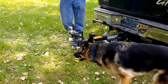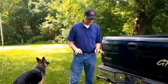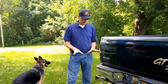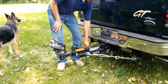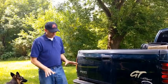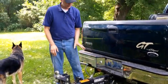This particular setup we have towed into the Rocky Mountain National Park and pretty much across North America, and we have never had a problem with it. The only thing you want to do is, after about 50 miles of driving, pull over and make sure these are still tight. What I've found is every once in a while I need to do a few more turns on these turnbuckles to make sure they are extremely tight.